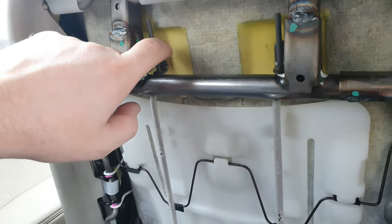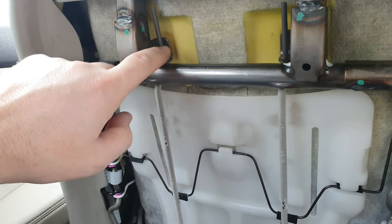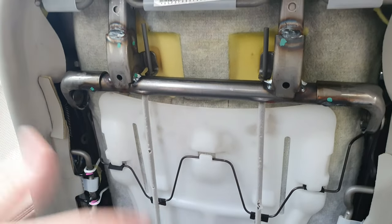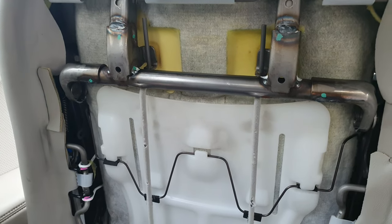This is a great fix — it's worked for me and it's worked before in a different car too. If you use oil, when you put it on the parts it will just start dripping off and then there's nothing actually stopping this part from touching that part, so it will eventually just wear off. You're better off using a grease rather than an oil.